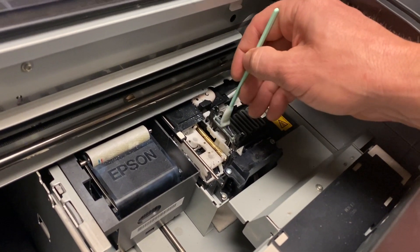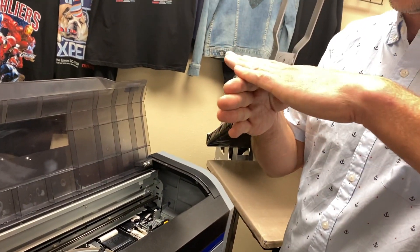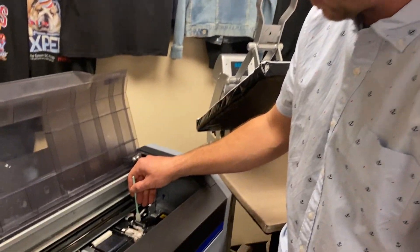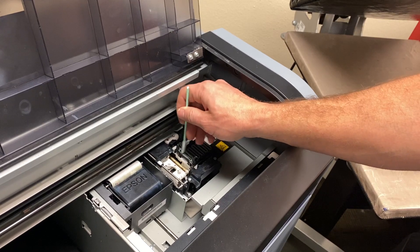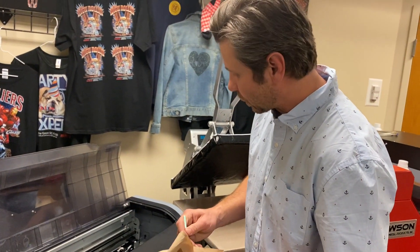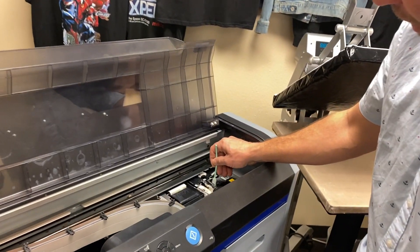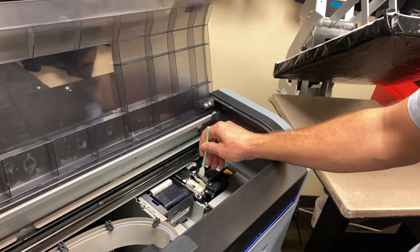The whole point here is that when the printer does its cleanings, it spits a little bit of cleaning solution and ink down into that head cap. That head cap comes up and sucks under the printhead, drawing ink and cleaning solution through as needed. If the holes in here are clogged, you're not going to get good drainage. And if the head cap itself is filled with residue, you're not going to get good suction. This is a pretty important piece to clean. There is also automatic cleaning that the printer does on its own that helps keep it clean.